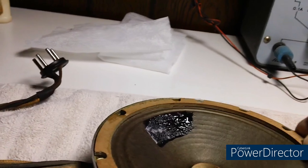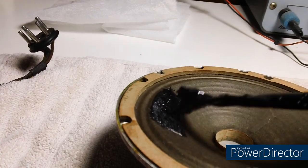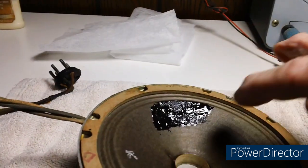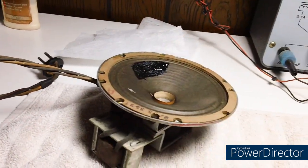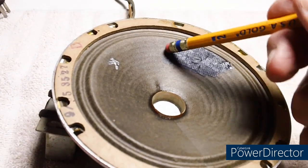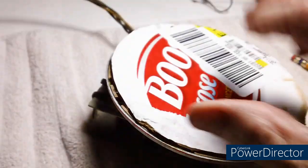Now go ahead and turn the speaker cone around like so. You can do this with even very large rips as long as the entire cone is intact — I've had holes as big as my thumb that I've been able to patch. We'll set this aside and let it dry. After it dries I'm going to put another little dab on the bottom — just a bit of liquid tape, no dryer cloth. This stuff is so versatile. There it is, nice and dry. A little thin coat is all it took to patch that one up — very tough. On the back I just went ahead and put a little dab on there; that's got to dry yet. When it dries on the back I'll put the tape on.